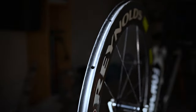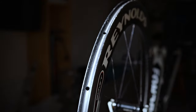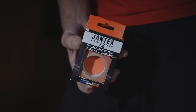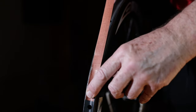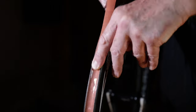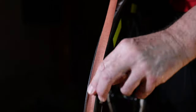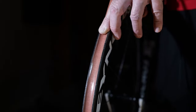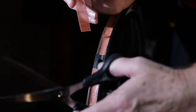Putting the tape on the rim can be a little bit difficult, so to make it easier so you can use two hands, use the bicycle as a jig. Put the rim on the bike so the wheel can spin and you can easily just stick the tape on. Start from the valve because the tape can't go where the valve is. Start at one side of the valve and gradually work your way around until you get back to the valve, then cut it with scissors. Remember not to remove the top tape — that comes off later. Just stick it on, leave the top tape on, and go all the way around. This goes really quickly and you don't need any tire levers.